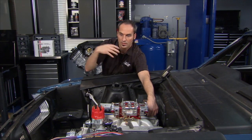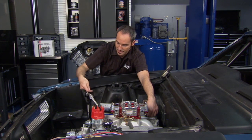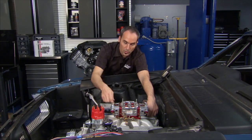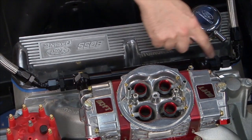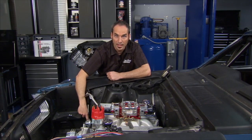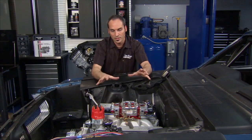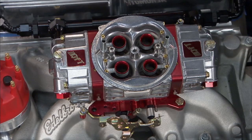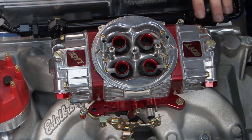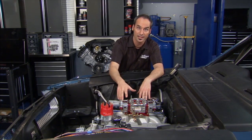But when you do a heavy load from idle to a drag launch, you can drain those fuel bowls. It takes fractions of seconds to send the signal to the regulator and get fuel flowing back to the carburetor. If you run it as a full log — inlet in, regulating through, and out — you've always got a flowing seven PSI instead of a deadheaded PSI. That's always going to give you the fastest response going from idle to heavy load, so you'll always have full float bowls, run consistent, no lean conditions, and you won't lose a tenth of a second on your drag run.